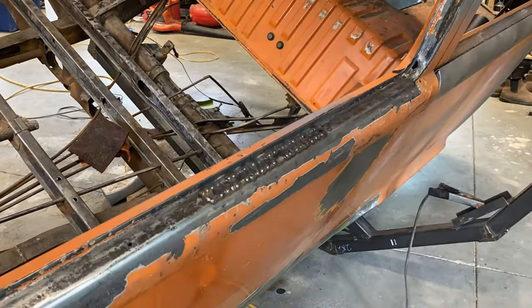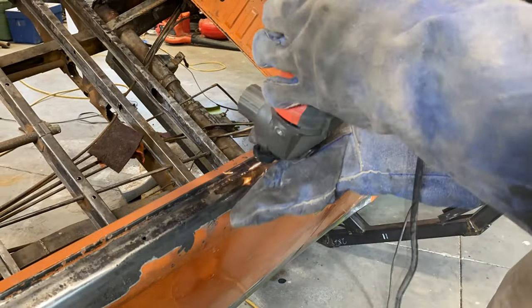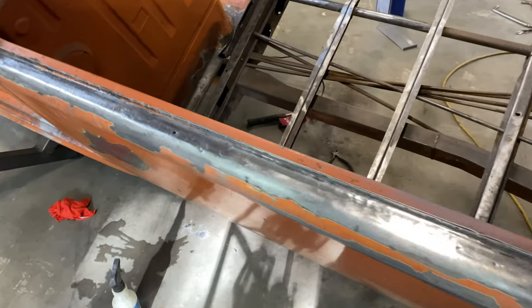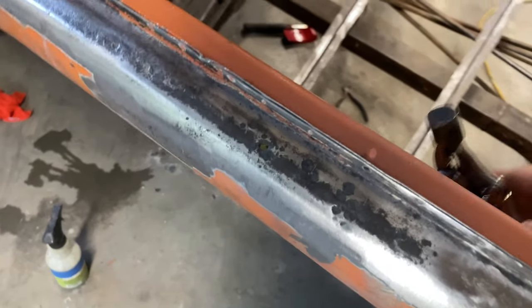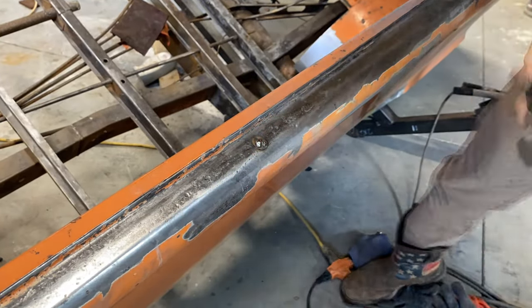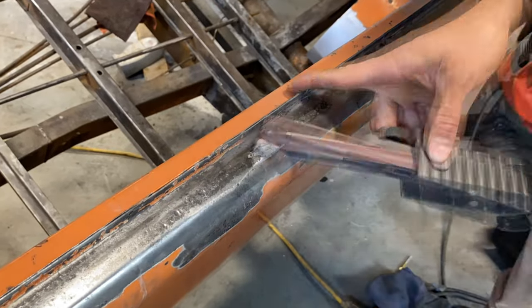With any MIG welding on thin sheet metal, you want to space your tacks apart, grind it down, and then fill in any gaps until you have a perfectly sealed surface. Take your time with the sanding — you don't want to overheat the metal or eat away too much material — and you'll end up getting a pretty smooth finish. For little holes like this, I'll use a piece of brass put up behind and seal it up with weld until anything that's rusted blows through and you reach clean metal. It works out so I don't have to cut out tiny little sections — that's the way I do it. I don't know if it's recommended, but it turns out pretty good.